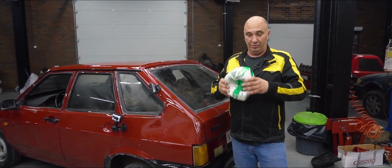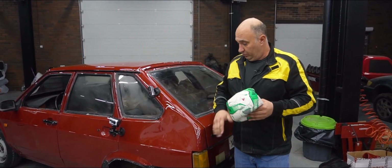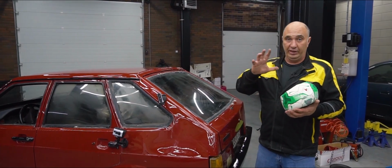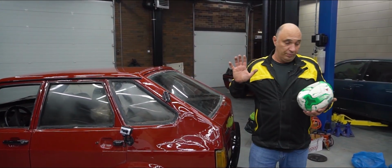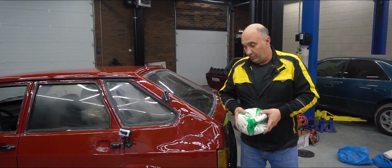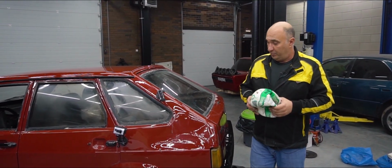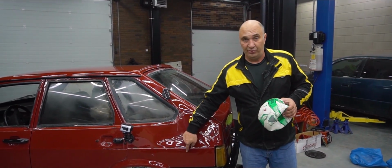You'd take a rubber bladder, stick it inside, fill it with some air, it would start taking shape, and so if you were dealing with these types of smooth surfaces, you could use one of those without doing any sort of damage, since that bladder would be touching the entire surface from the inside. Anyway, all that pressure would restore the panel's original shape. You'd have a 90% chance of it looking like brand new after popping it back into place. But that's if you don't have any serious creases or bent edges.